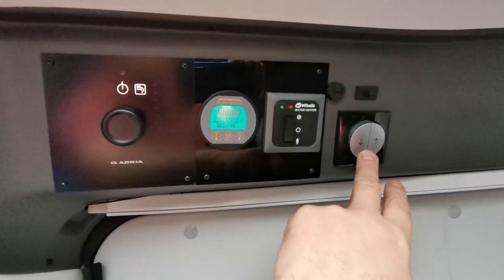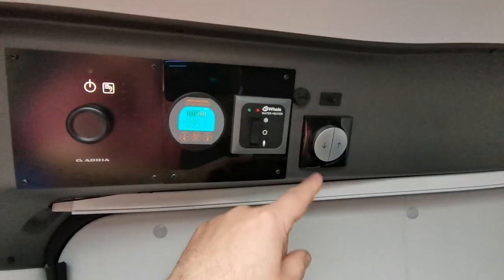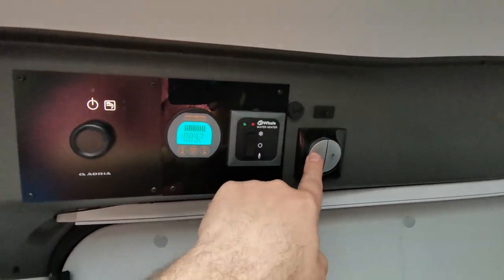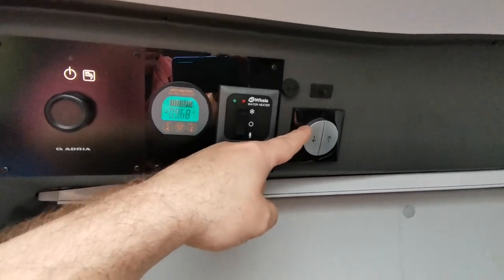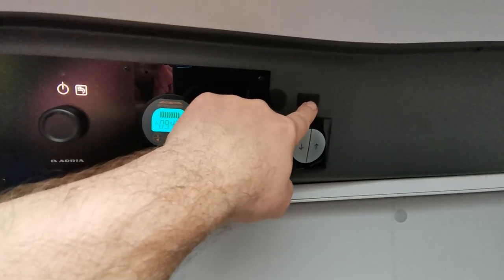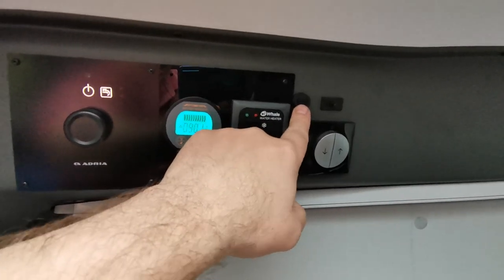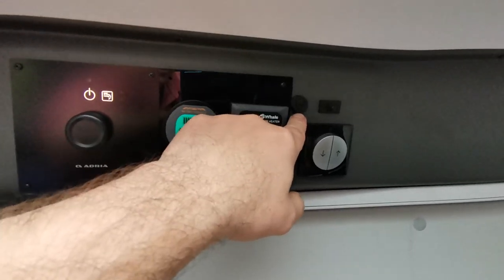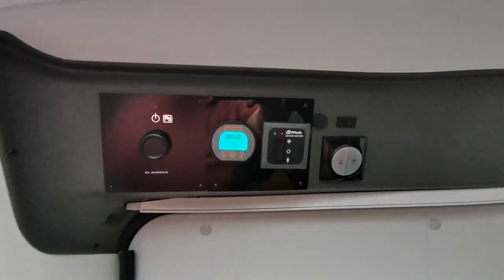Because we've got the SGX, we have the bed that goes up and down. Controls are up here and also at the back of the van. There's a reset button - if the bed hits the ceiling with too much weight on the motors it'll click out, and you push that to reset. The little black device is a temperature control for the cabin - it reads room temperature and sends it down to the Webasto diesel heater so it can maintain the set temperature.